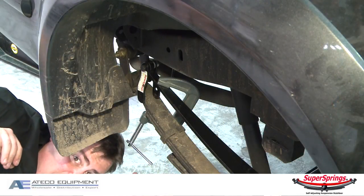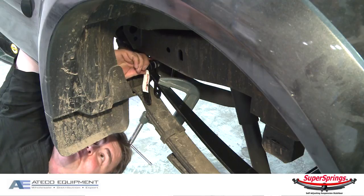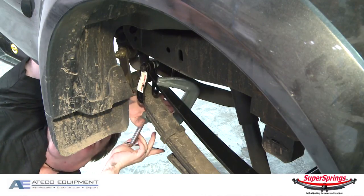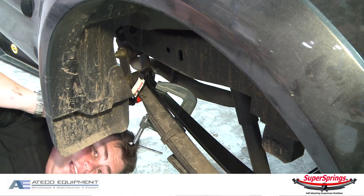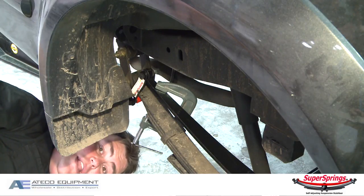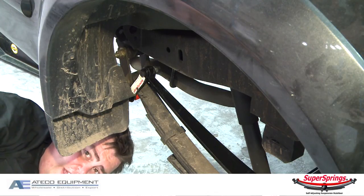When you get to the back part, or the second part of each of the Super Springs, you'll probably find that it is a lot higher than the other side was, because obviously you've done one side up. Just make sure you've got it relatively central east-west, have the shackle either side of the leaf spring, put the G-clamp on, and then wind it down into position. The final step here is just to make sure you tighten the lower shackle bolts — don't touch the top ones. Tighten the lower shackle bolts prior to releasing the G-clamp, because it's going to spring out of the way. Then release the G-clamp — you probably heard a big bang there, so be very careful when you remove it.